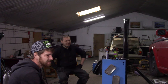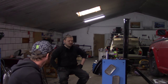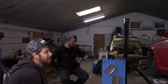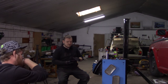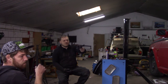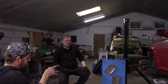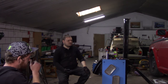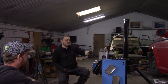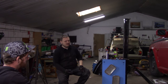It is really high still at the back. Yes, but it's with just springs, the shortest spring you can get. I say cut it. Yeah, chop it. But with some lower profile tires, the front is just clearing. If you get low profile tires, then the gap will be much larger than it is now. But make the front axle different from the rear? No. If you take the same tires, it will be the same. The only thing you could do to get some weight back into the back is raise the front. But it's not going to be that much of a difference.